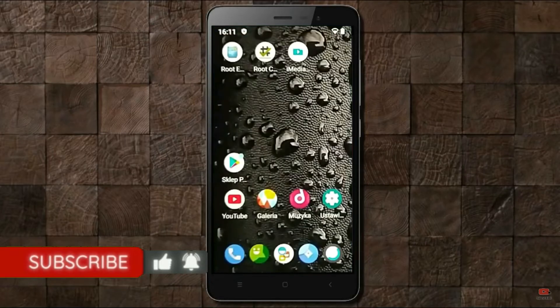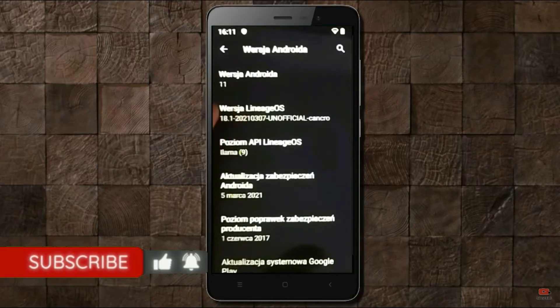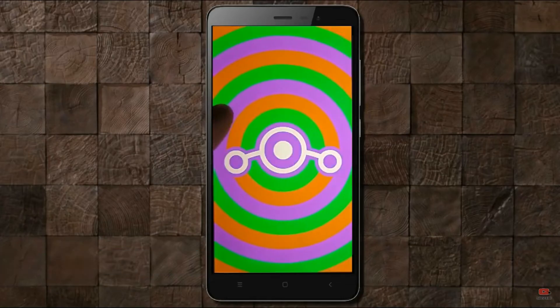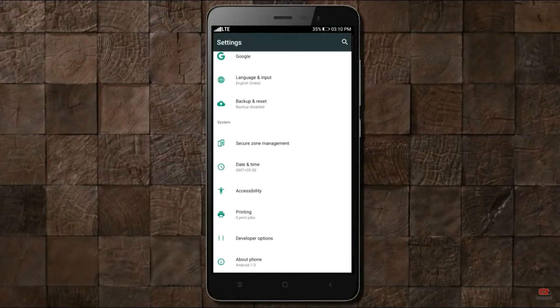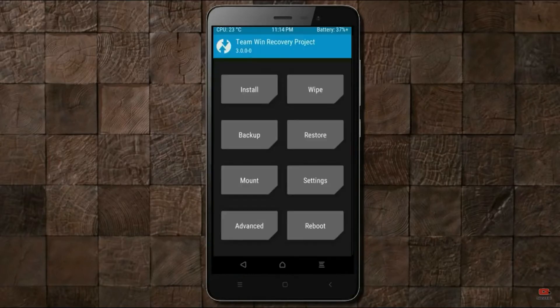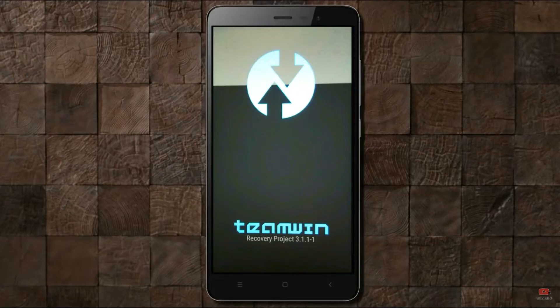Friends, if you want to get the real feel of Android 11 Easter Egg, then you have to follow this procedure. Before installing this ROM, we need to enable three steps: enable developer option, unlock bootloader, and the third one, install TWRP. Let us boot our device into TWRP recovery mode by pressing volume up and down and power button simultaneously.